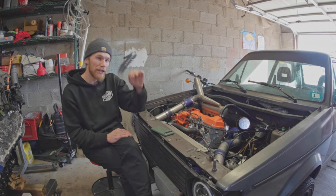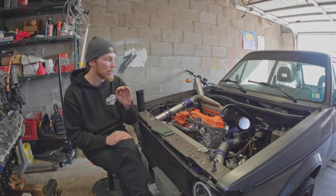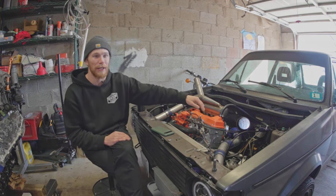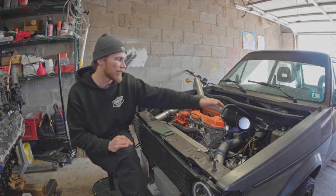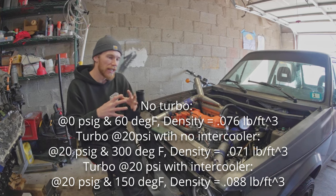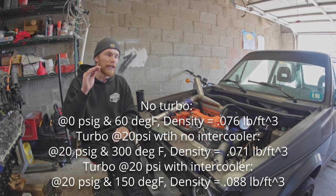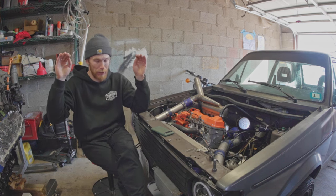The turbo is doing work on the fluid — as it compresses air, the air gets hotter, and it can be pretty drastic. Running even 20 psi of boost pressure, you can see intake air temperatures as hot as around 300 degrees just from the turbo. At 300 degrees that air is really not dense — the molecules are moving around fast. When you run it through your intercooler, which removes heat from the airflow, by the time it gets to the engine you have a much denser air charge, giving you more power. You're getting denser air so more power, and cooler air for a more reliable engine as well.